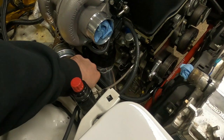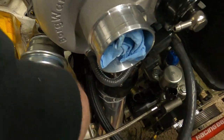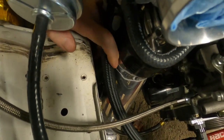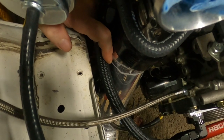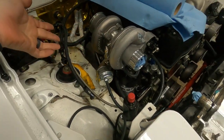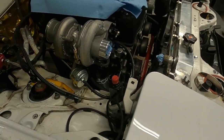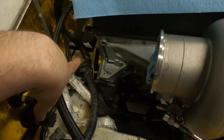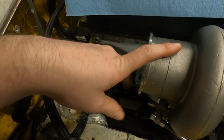The intercooler pipe is just kind of shoved in here for now, but you can see the amount of space I gained. I can slide my hand in there — that's how much room I have before the hose hits the wall. It won't rub through anything; it's a blunt object on a blunt object. The V-band is holding the turbo to the manifold and it's clocked correctly. Once I get my slave cylinder and put the transmission in, I can put that crossover pipe on and start building the downpipe.